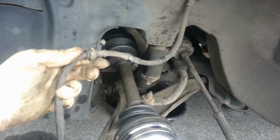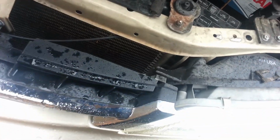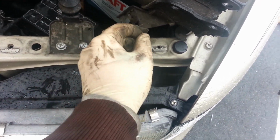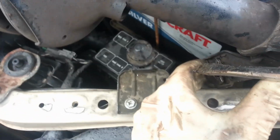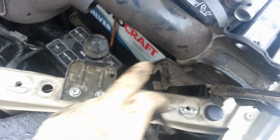Now you need to know how to get the strut out of your way, because you've got this brake line sitting here and it's sitting up something like that. And basically what you do is you're going to take your flathead screwdriver and a hammer. We'll come over here to my demonstration area. And here we have our piece, and our other piece that's going to be sitting right like this. So basically, you're going to have this little clip sitting in there, and the hose is going to be stuck in there, and you're going to take your flathead screwdriver, and sorry guys, I'm really struggling here with the one hand, but you're going to get under there. You can see I bent this up, and then you'll get on the other side and just bang, and this clip will pop out, and then your hose will be free.